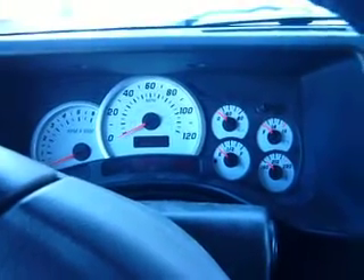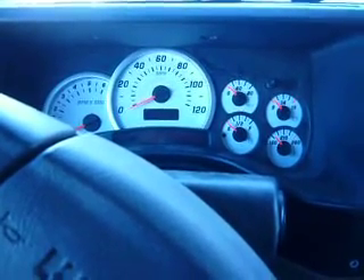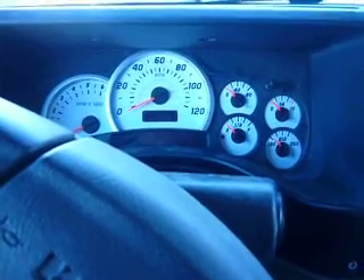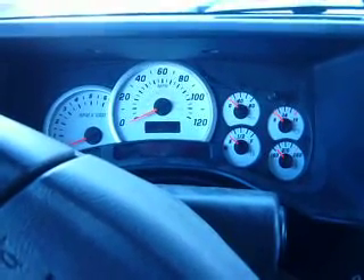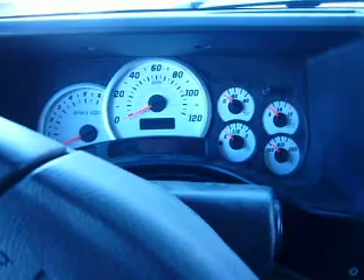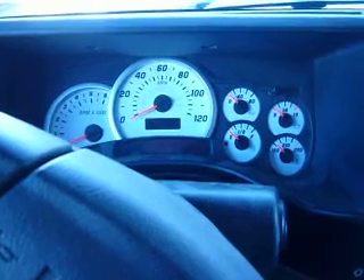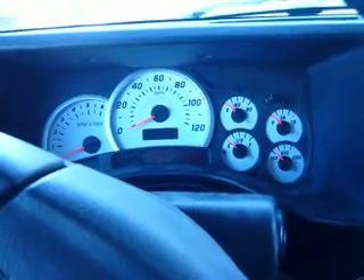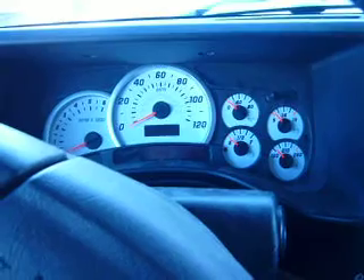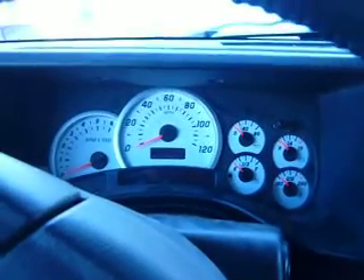I've also replaced the alternator just in case, and the battery. But now I'm still having an electrical issue. Ever since I replaced the battery, I seem to have ignition issues and there appears to be some kind of drain on the battery. I've traced it down to a couple of 10-amp fuses in the front — they seem to be powered whether the vehicle is on or off, when they really shouldn't be. That just drains the battery and all kinds of crazy things happen.